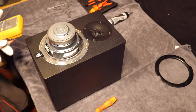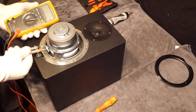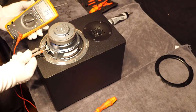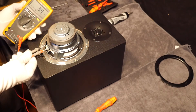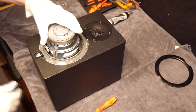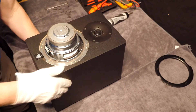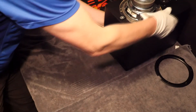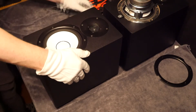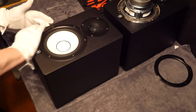Obviously it is rated at 4 ohms, so we will just see how close it actually is. Negative, positive — and what have we got? About 3.5, 3.4 ohms. I guess that is close to 4 with tolerances maybe. So what I will do now is pop that speaker to one side, and then I am going to take my fully working one, because what I need to know is whether it is the actual driver unit or the amplifier inside that is at fault. If I take this drive unit out and put it into the other cabinet I should then find out where the actual problem lies.